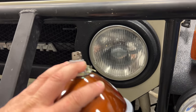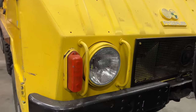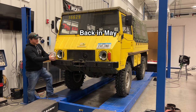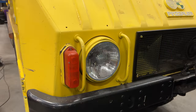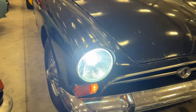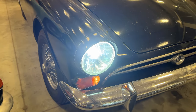I always get these without the pigtail or a fan — anything that's going to add extra depth to the light — that way you know for sure that these are going to fit in the original application. They even have a Hella version for your German vehicles. I started to make a video about these lights using my Pinsgauer months ago, but that video never panned out. If you have a Porsche, Volkswagen, Mercedes, or some other vintage German vehicle, these Hellas look perfect. Here's a set I have installed on my Sunbeam Alpine, which I drive more as a daily driver. I also don't have a battery in that car — I'm using an ultra capacitor — and the car only has a generator, so I want these lights to be bright but use as little power as possible. I've been using headlights from Vintage Car LEDs for years, and this is the first time I've used the square configuration. I bought an extra set to put on my bus.